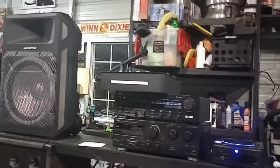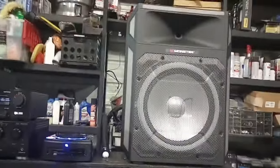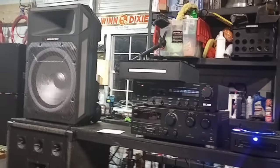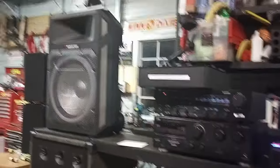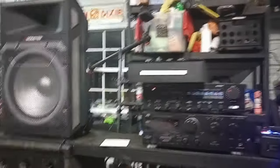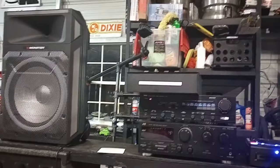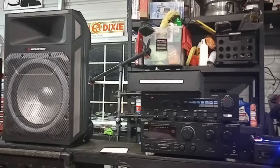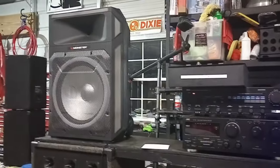That distortion issue applies when pushing them with a mixer. I've noticed when you're using Bluetooth or a USB stick, you can pretty much turn the bass boost on and crank it and it's going to sound pretty good all the way through, with just a little distortion at the very top. But if you're driving these with an external mixer pushing them hard, I would take the bass boost off. At lower volume settings for background music, bass boost on — you're great.